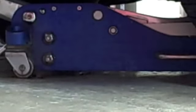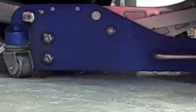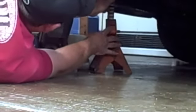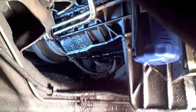Now we're just going to jack up the driver's side and put the jack stand up. Now I'm on the driver's side — right up here is the oil filter, and here's the line. You can see where it connects right to the top side of the oil filter and runs back. There's a 10 millimeter bolt right there around that grommet, so I'm going to release that. It looks like a 12 or 13 millimeter bolt, and then that line I should be able to work out.